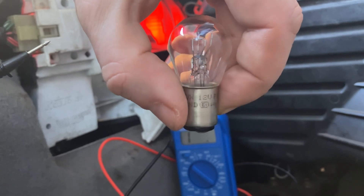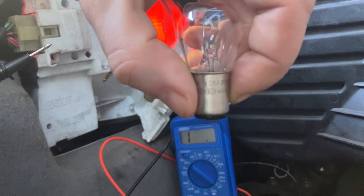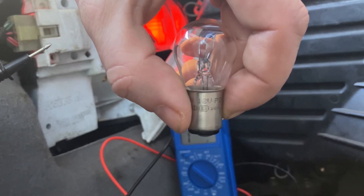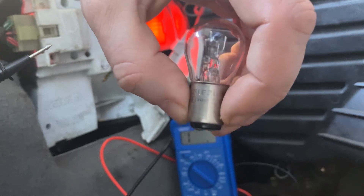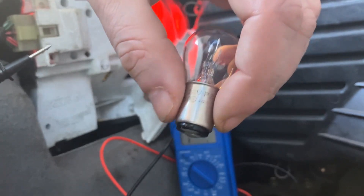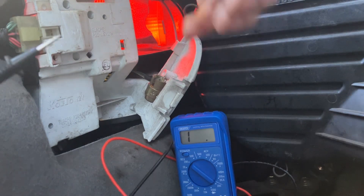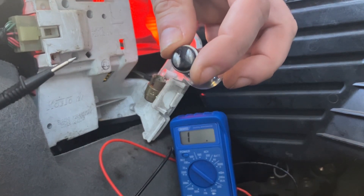They are used for your sidelights - when you turn your headlights on, the smaller of these two filaments, which will be five watts, will illuminate a red light to the back. And then when you brake, there's a switch on your brake pedal, and when you press it you complete the circuit and illuminate this 21 watt filament. Both are on 12 volts and share the same common earth, which connects to the body locally and then back up to the battery. The two contacts on the back are the two lives - the two ways the circuit becomes energized.